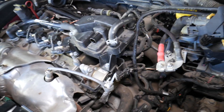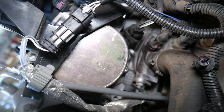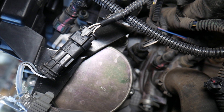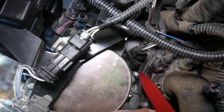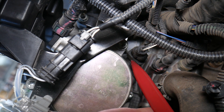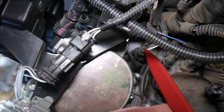It doesn't matter if you have a gasoline or diesel engine — if you have these codes, most likely it means problems with the camshaft position sensor. That engine will have one camshaft position sensor. The camshaft position sensor is right here — it has only one bolt that it attaches with. We have a video on how to remove it. If you have the code, make sure the wire is not broken and is plugged all the way in. Sometimes people will disconnect the camshaft sensor when working on the car, pull on the wires, and they'll come loose — that will cause that problem.